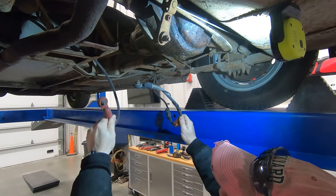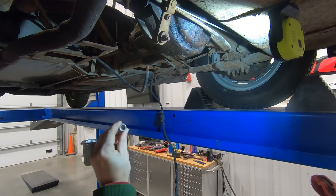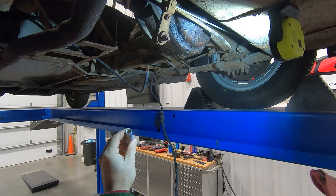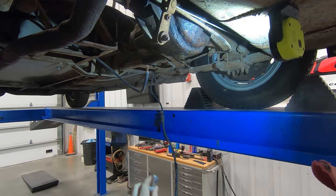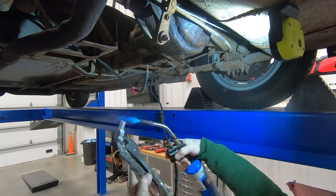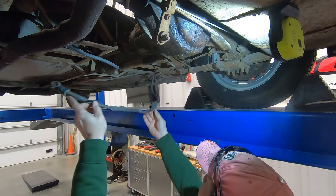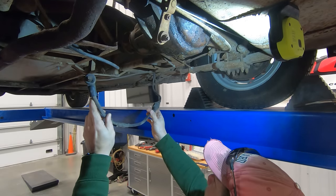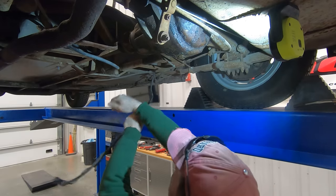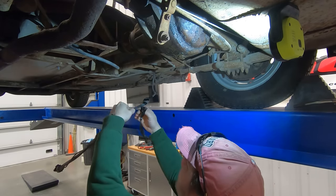Here's my new top-post terminal — these come pre-loaded with solder, so all I have to do is heat this up with a torch and put it on the wire. But first I'm going to put some heat shrink on here that I can move into place once this is soldered on. Before I put a terminal on this side, I want to check out this cable under the tape. This electrical tape turns into a gooey mess after it's been on there a long time.